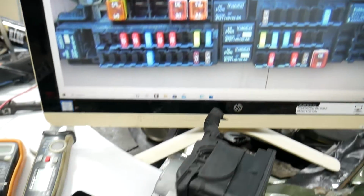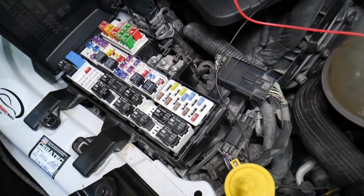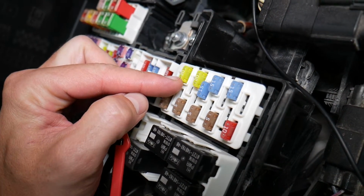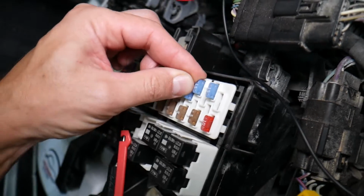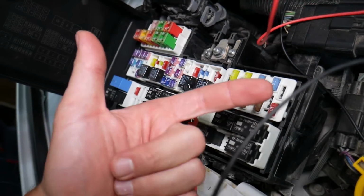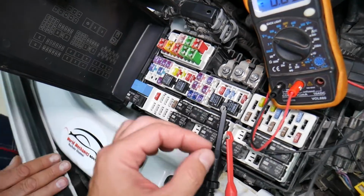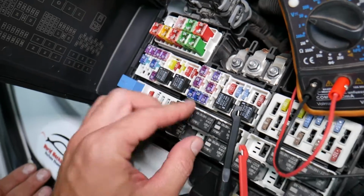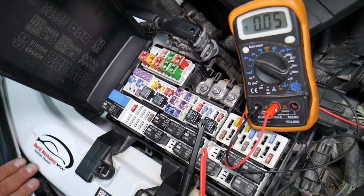Before we continue, let's explain quickly why it's always a good idea to test fuses and relays. So let me explain why it's super important guys to test fuses. Often you can't see if they're burnt or they're good. Sometimes they may seem perfectly fine, you think it's a good fuse, you put it back in and you end up spending money and time on parts and problems that do not exist guys, when all you had to do was test your fuse, find out it's bad, replace it, fix your problem. So we will have a video on how to test a fuse, different kinds of fuses, and how to test relays guys. We're going to put the link in the description of the video below specifically to that video.